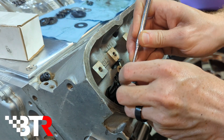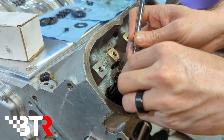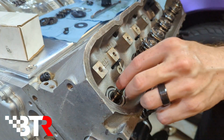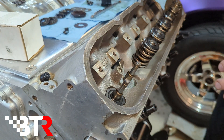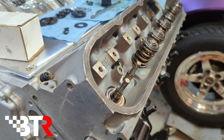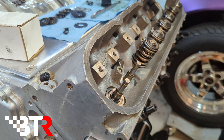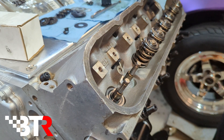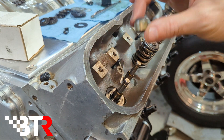Once you get that done, you've got to take this off and pull the tool out. Now a crucial step — you definitely want to make sure you don't skip putting the valve seal on. I've done it before, got ahead of myself, got that all figured out, and next thing I know I'm jumping straight to putting the spring on and completely skip putting a seal on.